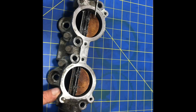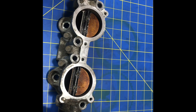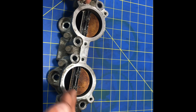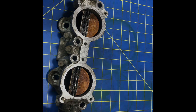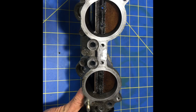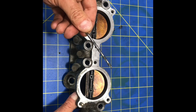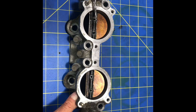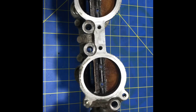One thing to mention: try not to scratch or mar any of the inner bore surface — you want to keep this inner surface totally smooth and try not to damage the rod. This rod is going to have to rotate still; there's a little motor in here that rotates the rod when the engine gets warm, and you want that rod to be able to rotate so the sensor doesn't trip any fault codes for your ECU. That's what it should look like after drilling — no damage to that rod.